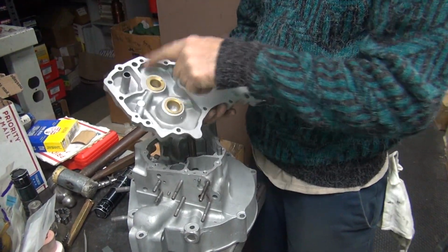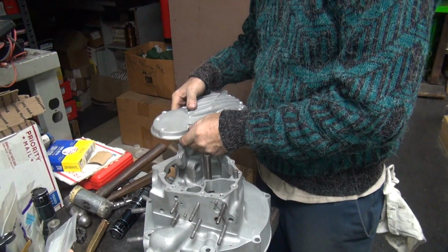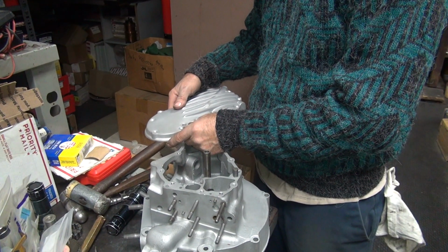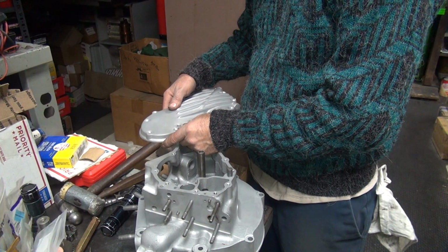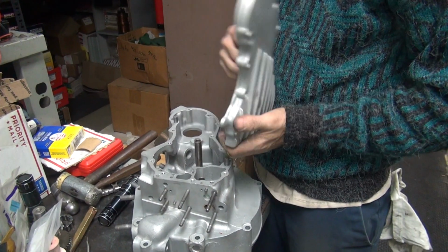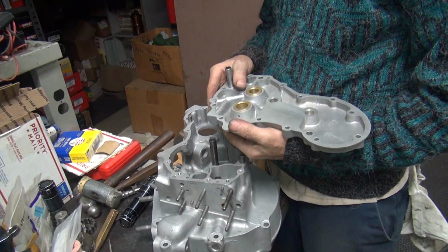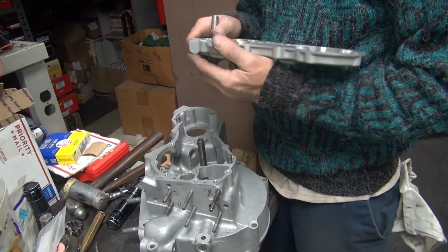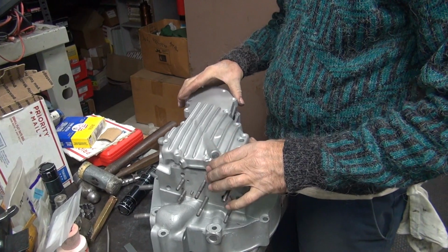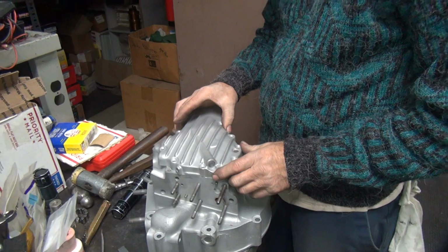No, aftermarket makes their bushing holes, their dowel holes, real loose so that they will go on. They fit applications. So when you've got an extra 5 thou clearance, that's a lot of clearance in there. That's 10 thou. You can't have precision if you make your precision parts loose as a goose. That's the problem with everything aftermarket. They make it really loose so that it will fit on most every application out there. So it basically sucks, but it makes it easy to put on.